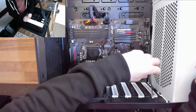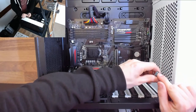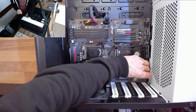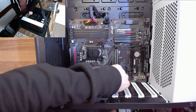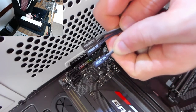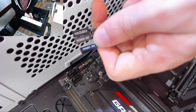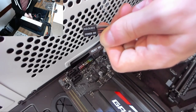While we're connecting cables, let's do the extra front panel connectors. The audio connector has a blank soft pin and a corresponding missing pin on the motherboard's audio connector — that's how you know the orientation. Push the excess back into the case interior. The noodly front panel connectors are for the power switch, hard drive light, and so on. On this case we've got three because the power LED is powered from elsewhere, but you'll probably have four: a power LED, hard drive LED, power switch, and reset switch.